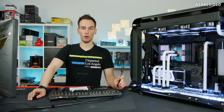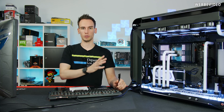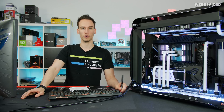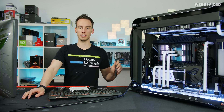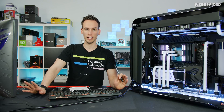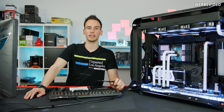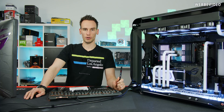For the next video, we'll do all the configuration we can: fan setup, memory speed adjustment to run modules at the correct speed, possibly memory overclocking if there's headroom, CPU overclocking, GPU status and temperatures, maybe some Titan overclocking, and SSD performance — including checking the cooling impact of the cooler on the back for the PCIe SSDs. I'll be on vacation for about two weeks, but I'll have videos coming anyway since I'm spending this week producing content so I can enjoy my holiday.